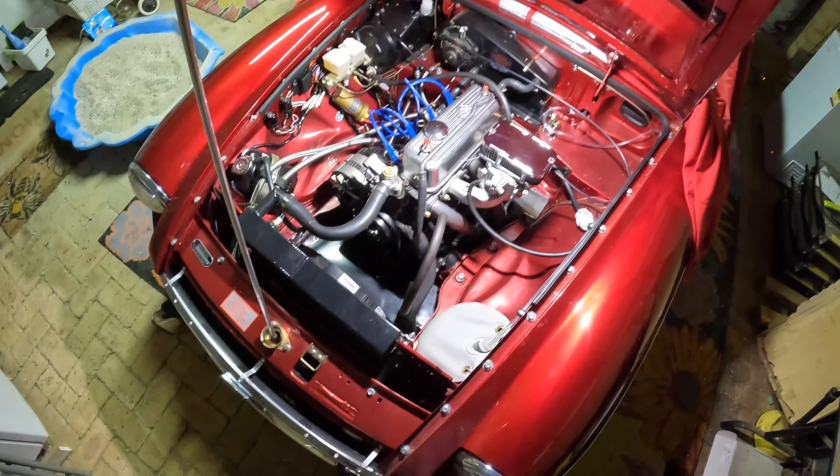So this is more of a diagnostic video. It's been very frustrating and it was a problem I was not expecting to find. I'll leave the 32/36 on now. I realise it wasn't a problem with the HIF carburettors — and it's funny because the servo connection was on the right-hand side on the HIF manifold as well, which is why I was having the problem with three and four. I checked all the compressions: 175 psi in each pot, so no problem there. Hopefully this helps somebody — don't assume the servo is alright because it might not be. Thank you to subscribers and watchers, and hopefully somebody will get some value out of this one. Bye for now.